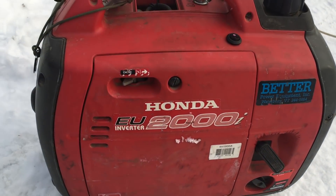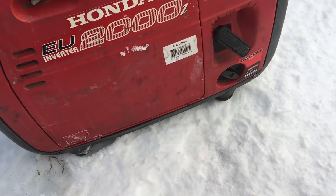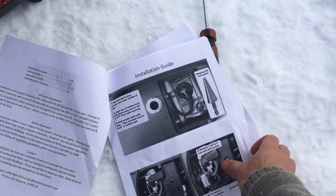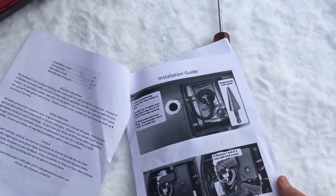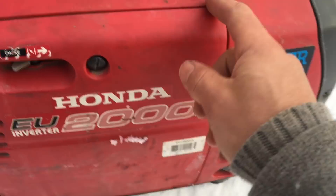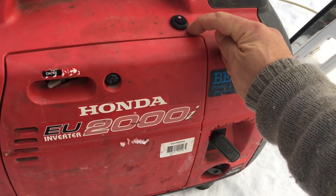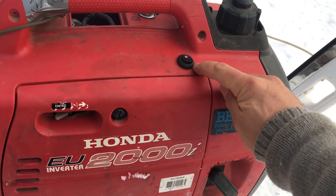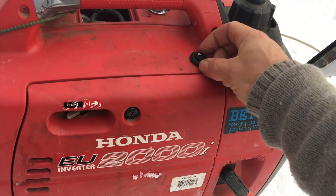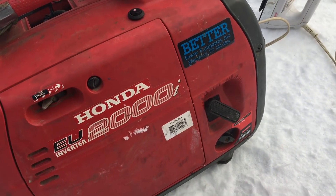This is a super tight system — I'm really impressed with the Hutch Mountain kit. It's definitely more carefully thought through than the others, and it installed in about 20 minutes including drilling the hole. The manual is much easier to follow than the manuals on other kits. They even send you stickers so you know the new configuration. The hole is listed as 11/16ths, which is a little tight — I might go a 16th or 32nd bigger.